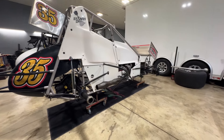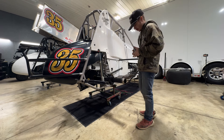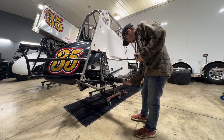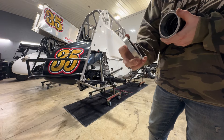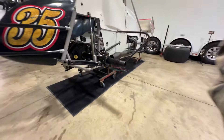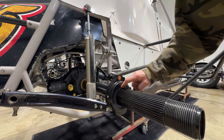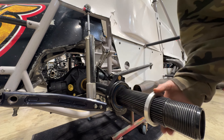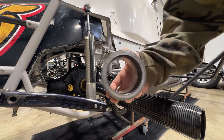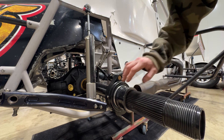There's our body. Next step is wheels and tires, then we'll be able to set this thing down. Starting with the right rear — I keep all my spacers together so I already know the right amount. The first thing that goes on is a half-inch spacer — you can see where there's still some silver showing. It's slightly bigger in diameter than the next one, so that goes on first to make sure the birdcage gets tight. The only threaded one I use I never go in further than that.